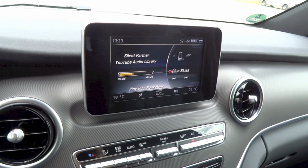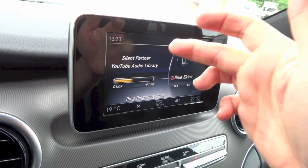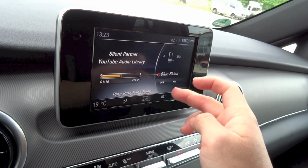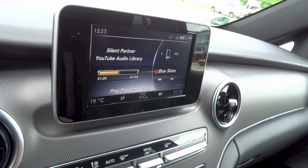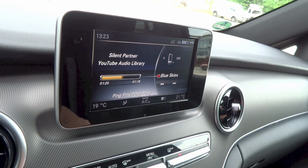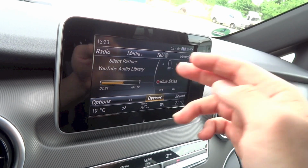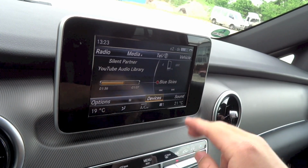Right now, we are in your main Bluetooth audio streaming menu with your current song playing information, with the artist, album, song duration, current device connected name, song title. You can go back a song, go forward a song just by clicking the knob to the left or to the right, or twisting the knob to the left or to the right. But if you click the knob down, you bring up your list of options. Now, the command system works in a 3-tier format, so you do have your main menus right above, submenus in the middle, and the options for the submenu down below.